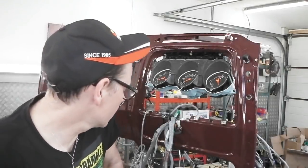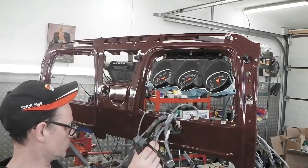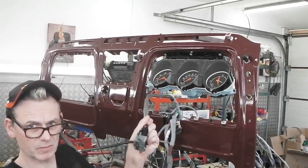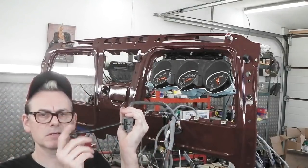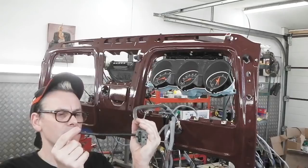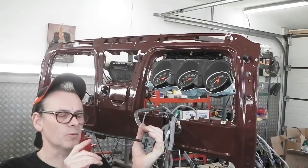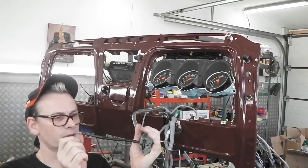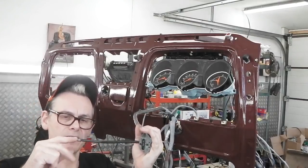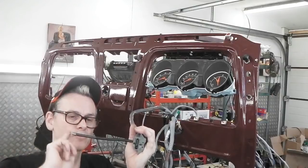Okay, so up at the front there, you'll see there's twin stalks just on screen. Two stalks, normal indicator in my right hand, the cruise control and wiper arm system here. And this is what I was doing, up and down on that stick, intermittent or fully auto. These options on it are for cruise, so that's no power to the cruise at all. Up, that'd be dip beam in normal circumstances if it was used in a car as it should, but we're not using it for lights. That's power to the cruise. Cruise won't come on yet till I press this and I'm going over 35 mile an hour. So press the horn, which would have been the horn, cruise will lock on.